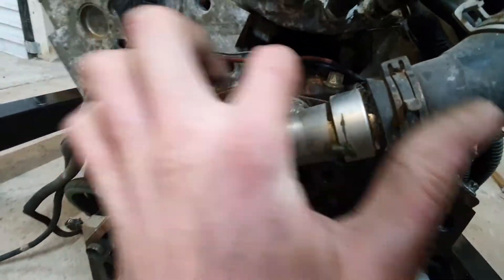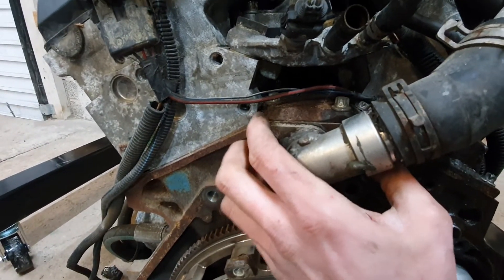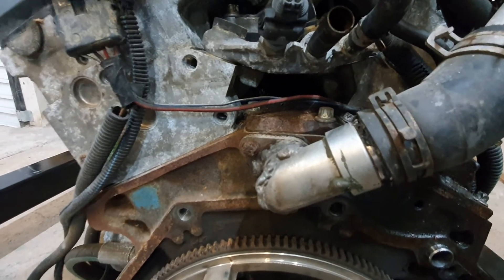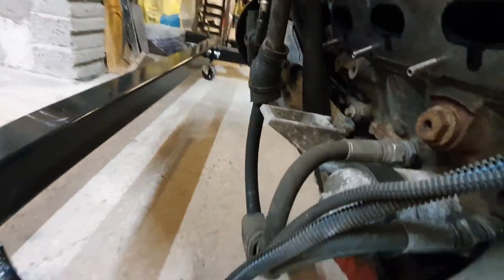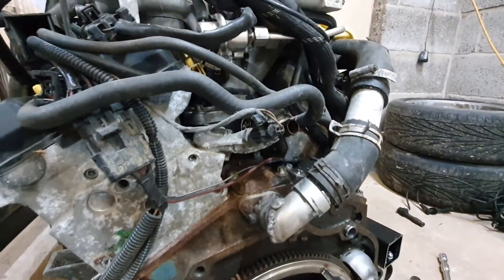The last thing here is on top of the X30XE V6 engine — you get the oil cooler pipes. There's a huge channel in there with a lot of coolant in it, and it's filled with an oil cooler. They have a tendency to let go of the seals and leak. So to get around that, I got rid of it, made a blanking plate, skimmed it on the lathe — quite a neat job, though I should have painted it obviously. That seems to be holding the coolant in nicely. Instead, I've taken those coolant pipes at the side of the block, and they go to a Mocal oil thermostat and then down to a 50-row oil cooler — air to oil, not water to oil. The benefit of the original water-to-oil cooler was it heated the oil quickly with the coolant, which is great, but I've lost that advantage. Of course, I don't drive it very hard until it's warmed up.